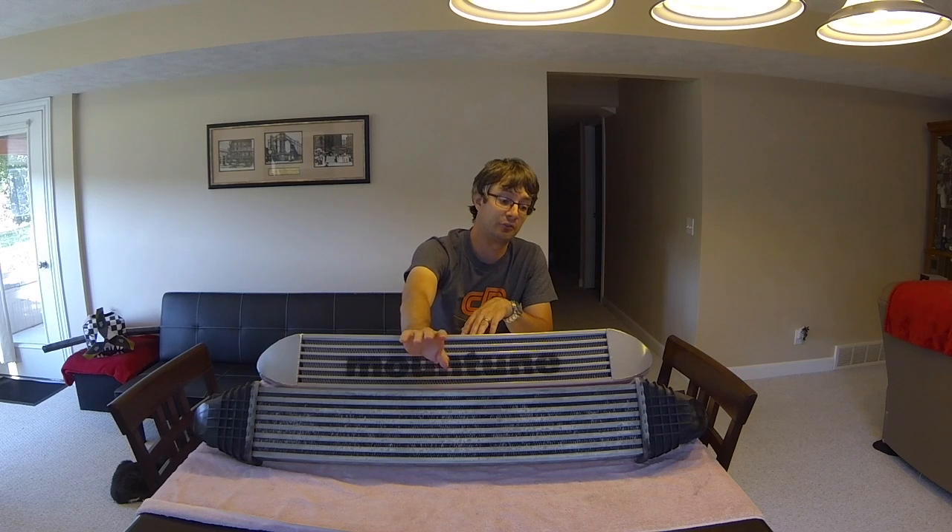The next step for me is to actually get this thing installed. To do that you've got to remove the front bumper cover and the front headlights. Mountune provides really nice instructions, and you can also get instructions from your local dealer if you want to see how Ford recommends doing it. I estimate this will probably be about a two to three hour project — the second go around I should be able to cut quite a bit of time off. So there you have a little bit of intercooler tech, a little bit of review on the Mountune intercooler, and a comparison of what a 30,000 mile factory Fiesta ST intercooler looks like. Make sure you guys subscribe to the BRGT350 YouTube page — we're going to get this thing installed and come back with a review video on what we think of it compared to what I took off the car.